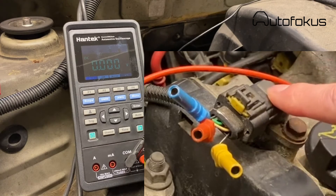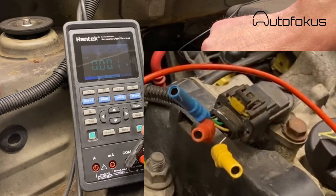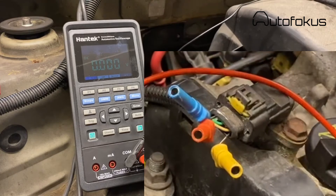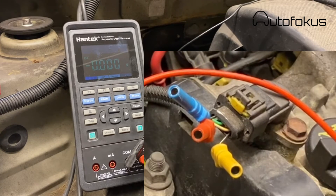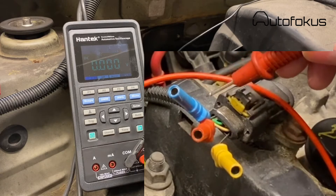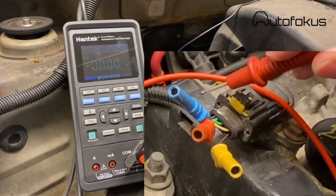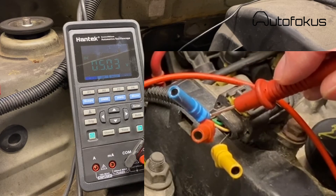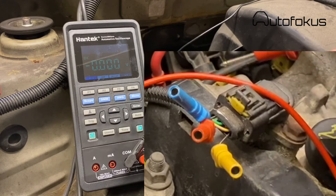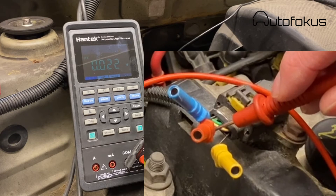It's a hall sensor measuring the piston position. What I have done with my voltmeter — you need to connect it first of all to chassis ground. I would connect it directly to the battery negative terminal, and I'll tell you why: because then we can use that as a reference later to verify the earth connection. I have actually back-probed each wire. Now you can see we have 5V — it could be the supply — and on the next one we have 22 millivolts.